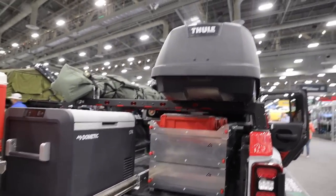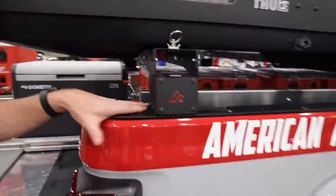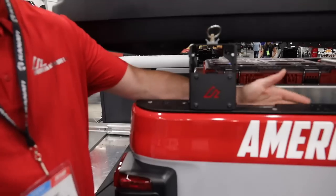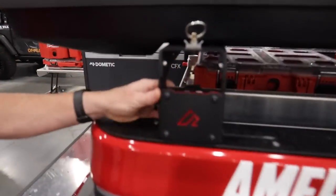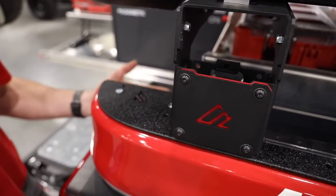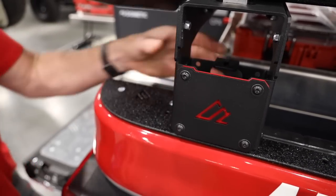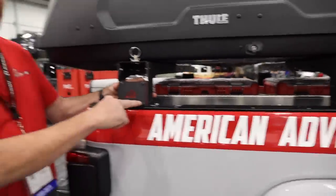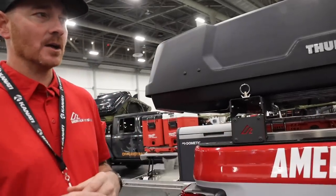And above that, we have what we're calling our bed rail attachment system. So the unique part about this that we did the patent work on, so I'm pretty excited about it, we don't go inside the bed rails. So these brackets here that you see mount directly through holes down into the sides of the bed, and they attach to a bracket that we have underneath. So the same as we do in the bottom of the bed, on the bed rails, we also sandwich that bed rail in between. We make a really strong mount, which is kind of hard to tell how strong it is here, but there are literally only two bolts holding this in, but it's attached to this bracket system underneath that again distributes the load across a wide area.